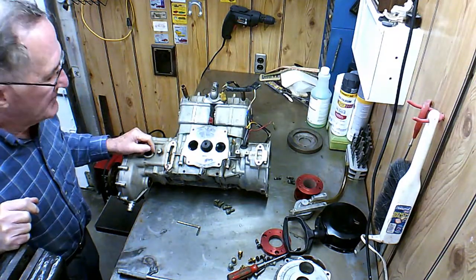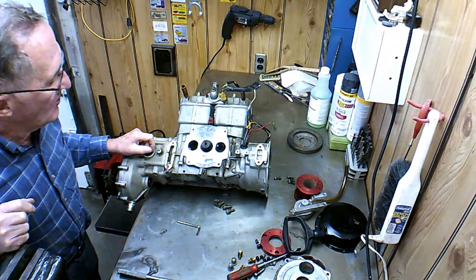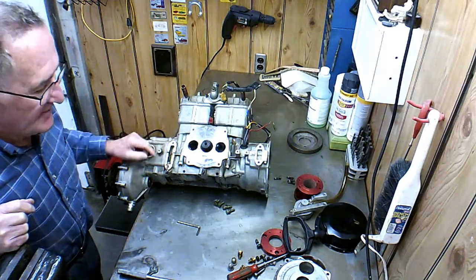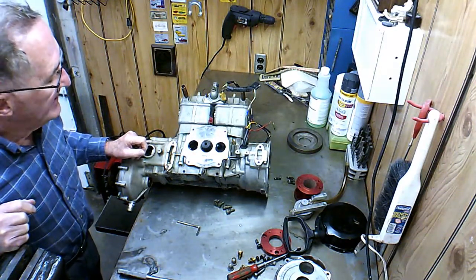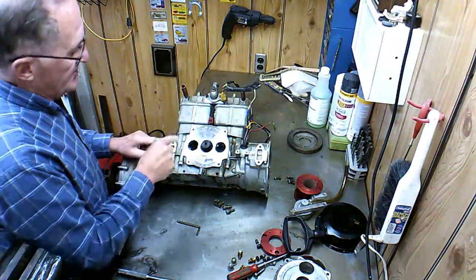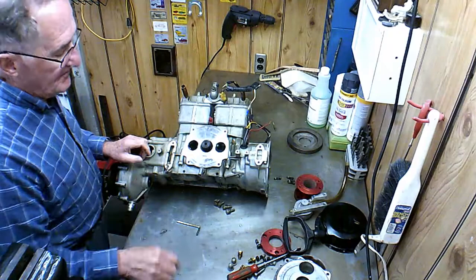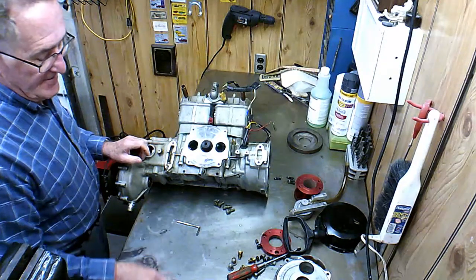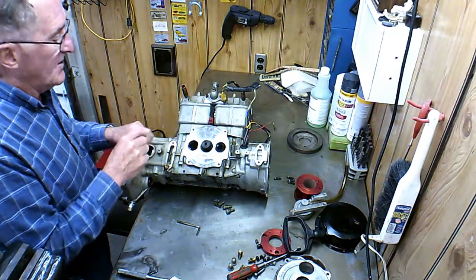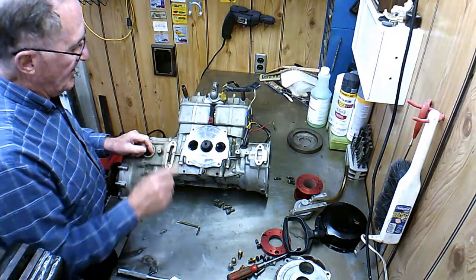It's not really a pump. I'd call it more of a metering valve than a pump. It won't draw anything. The oil tank has to be mounted higher than this thing they call a pump, and the oil has to flow in there, and then there's a piston that takes a stroke and pushes a certain amount of oil into the engine for each revolution of this pump, and that stroke varies in length, so it could take a longer stroke or a shorter stroke. If it's at an idle, the piston's just barely moving in that pump, and it just pumps in a little tiny bit of oil.